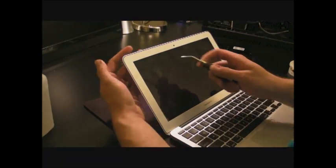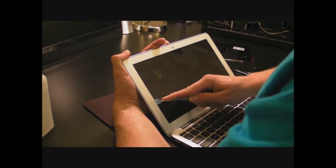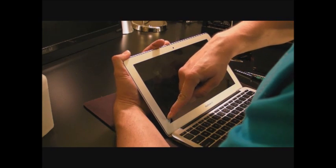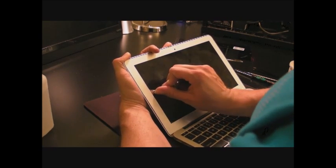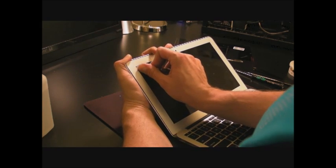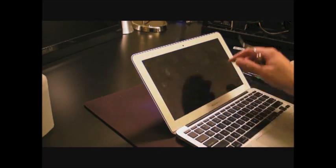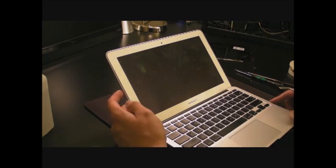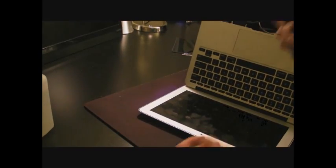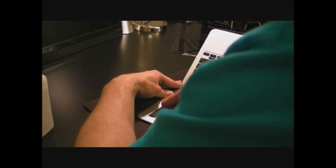Put the knife in a little bit — you can feel how hot it is. Slide it in like this, all the way down. Don't force it too much; if it's not budging, heat it up a little more. You don't want to damage and break the bezel. If the bezel ends up warped and twisted, you'll need to buy another one. One important rule when fixing these computers: don't make the computer comfortable, make yourself comfortable. I twist and flip the computer to whatever position is easiest to slide the knife inside.